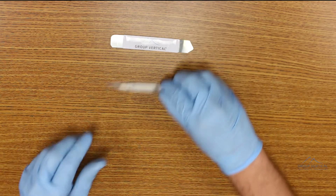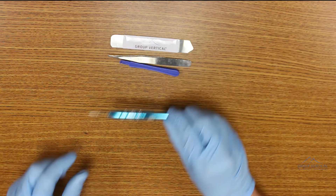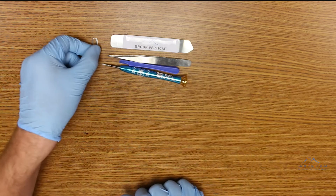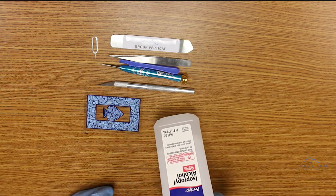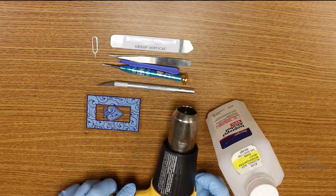The tools you'll need for an S9 repair are a thin metal pry tool, tweezers, plastic spudger, a 00 Phillips head screwdriver, SIM card removal tool, a razor blade, plain cards or guitar picks, some isopropyl alcohol, and a heat gun or heating pad.